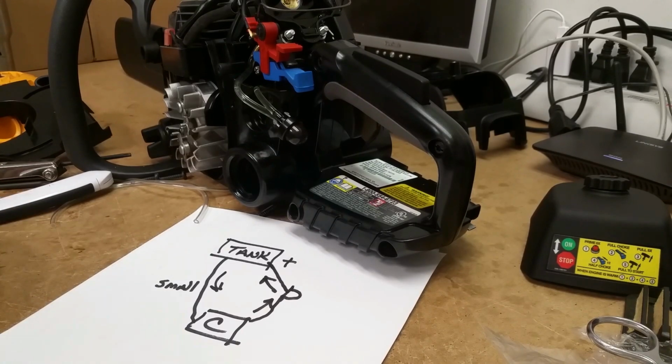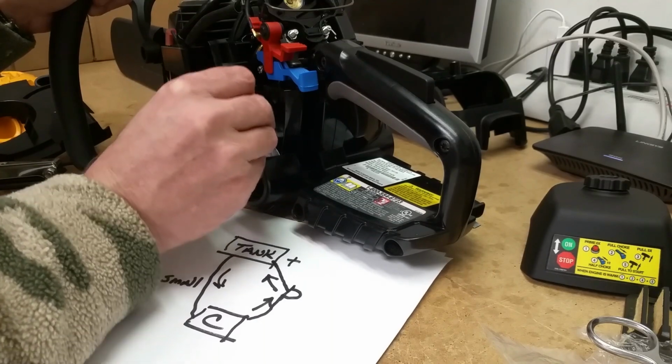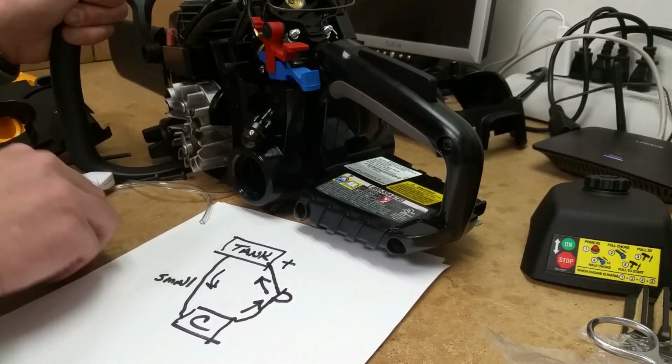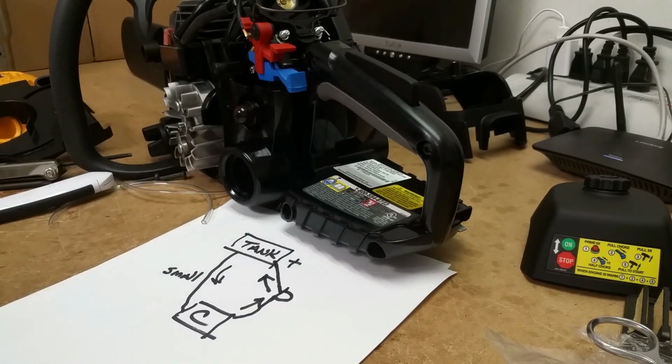Right? The point of the matter is, like I said, I ended up taking it apart a couple of times because the person I lent the chainsaw to had reversed the lines going to the bulb. They had the thick line hooked up with this little connector to the fuel filter. So it was just all backward. But it ran, but it's not exactly right. So now you've seen how to do it exactly right. Again, please give it a thumbs up. Let's try to get this to the top so that a lot of people don't waste as much time as I did. It should have been a 15-minute job. I ended up having to do it 3 times because every time I turned around I found, oh, here, I should have done it this way because that's more correct.